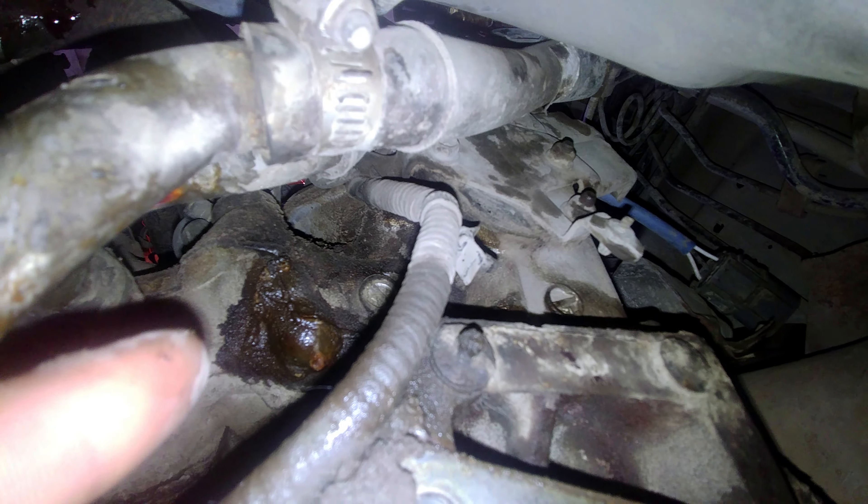Going down, here's another connection to the metal tubing — this one is leaking. There is another one over there, and it's not leaking yet but it might start any time. Going further down, there's some rust and corrosion, another hose attached, and there is a gasket in between the cylinder head and lower intake manifold that is leaking too. It looks okay on the driver's side, but there are lots of points where coolant can escape.